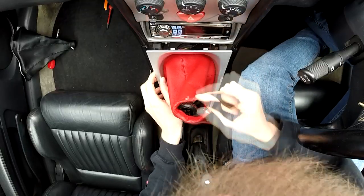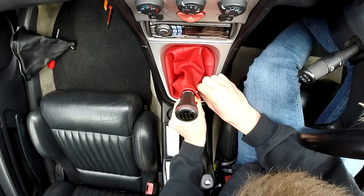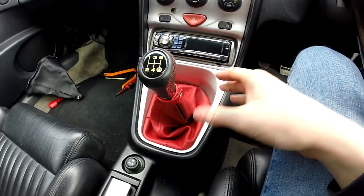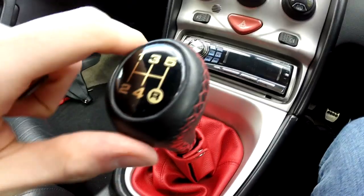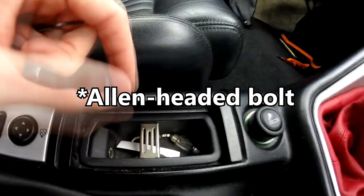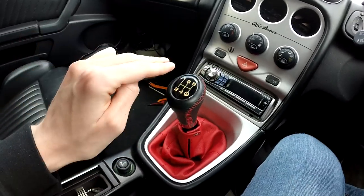These little ears at the front have to go on first - and that, ladies and gentlemen, is in. Velcro that baby up, button that baby up. That is on - how much better does that look? You can't smell it, but there's a lovely fresh leathery smell in the interior now as well. You may remember I complained of a rattly gear knob - well, it turns out this bit unscrews. It's held in by an allen key, much like the Seicento one. And in the ashtray I found the allen key that does it. So I unscrewed that, tightened it up, and it's pretty much tight now.